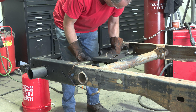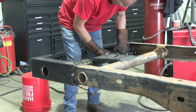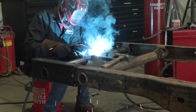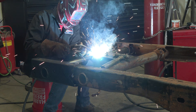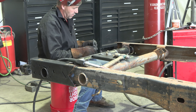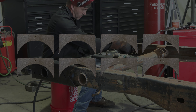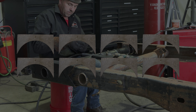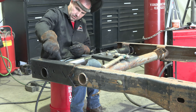Step 3. Slide your tube style rear frame crossmember into place, one side at a time. Following proper welding procedures, tack weld the crossmember to the spare tire plate before fully welding it. Our part features eight support plates to fit on the top and bottom of your inner brackets located on each end of your crossmember. Hold the plates up to the frame and tack them into place.